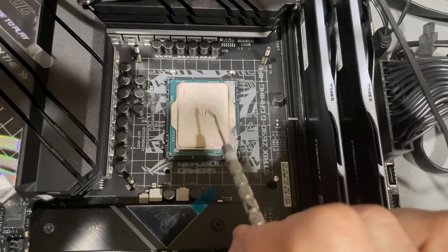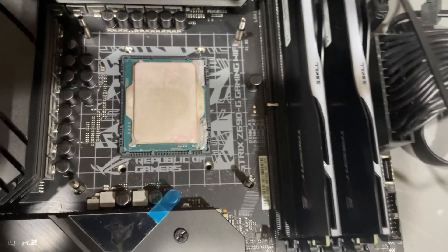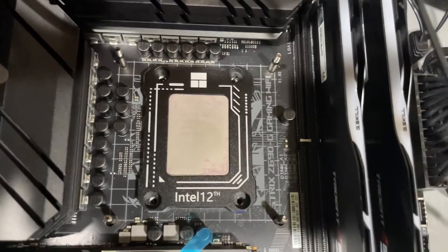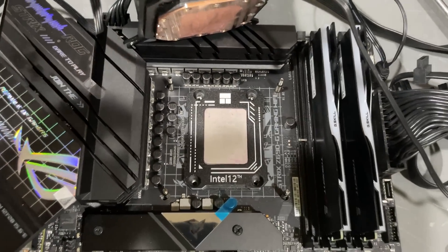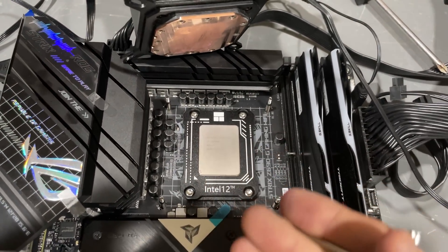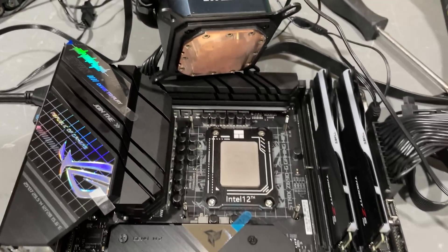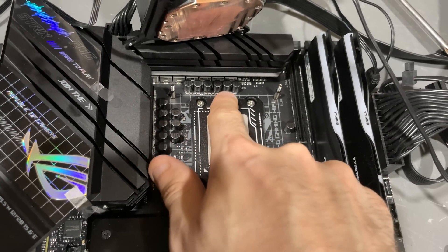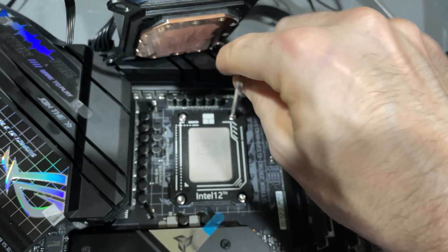This is just to keep the IHS in the center because it's delidded, but it's cut away so it'll apply even pressure on the whole thing. Look at this — it looks like it fits dead on. That's some pretty tight machining there. It actually looks really nice. Let's screw her down. That looks sick. You wouldn't see this while it was on the computer running, but for that PC aesthetics, that looks pretty sweet. You can also tell it's definitely sticking up out of it maybe by one or two millimeters. So it's definitely not in the way in terms of the cold plate whatsoever. It's quite well designed.